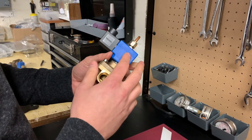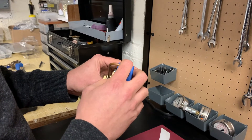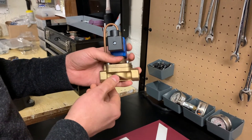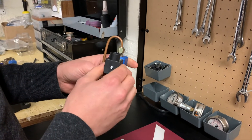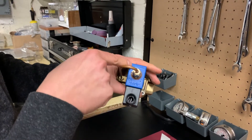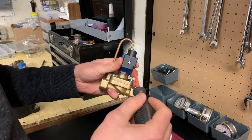One other thing to note: this is a magnetic valve, and as long as this valve is getting 24 volts, it should close when you start the compressor. If the valve is not closing — meaning all the air is being drained from the drain pipe — there's a big chance you're either not getting 24 volts to the valve (you can see the voltage rating on top, it says 24 volt), or the magnetic part is not doing its job.